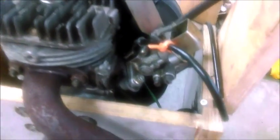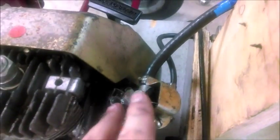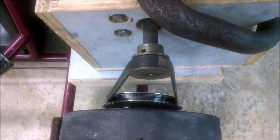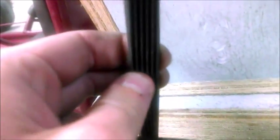You have a variable throttle right here — that's this cable coming down, goes down here, goes down the side, stops right there in the linkage. Adjust the throttle knob on the carb right there. The choke, which is right here, we don't use — just starts on its own when you push it. It's a four-and-a-half to one belt drive, the same five-eighths inch grooved belt that was on the snowblower originally.